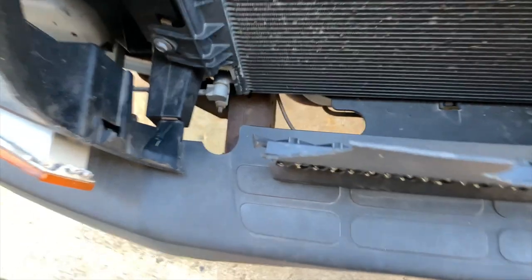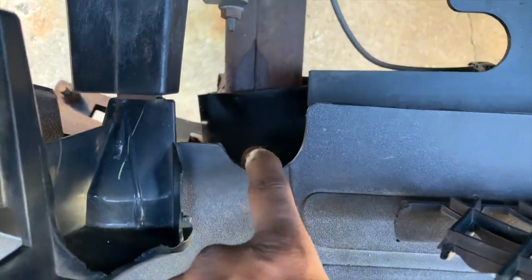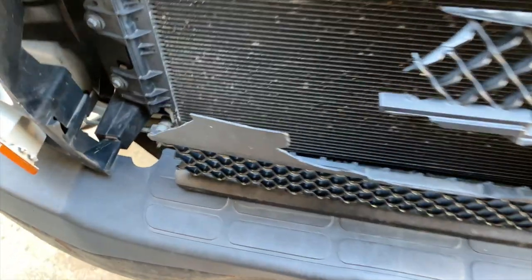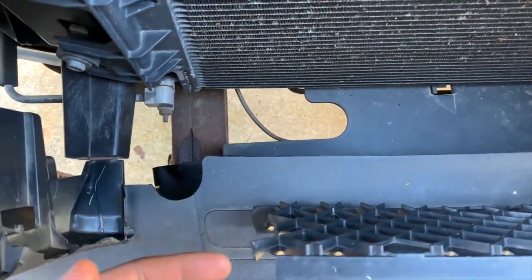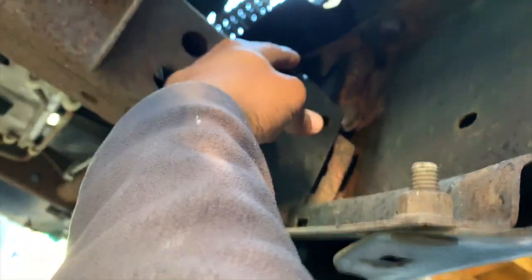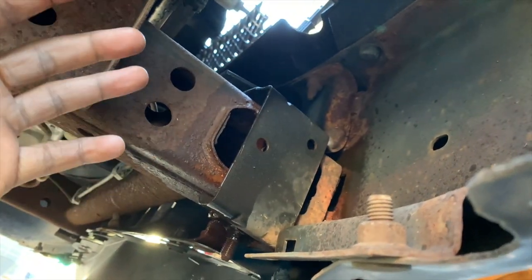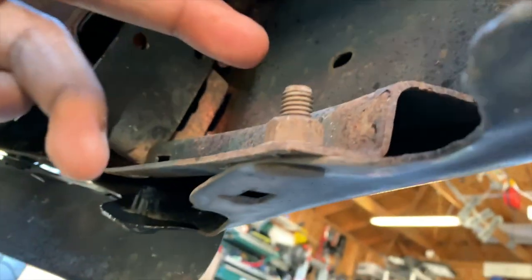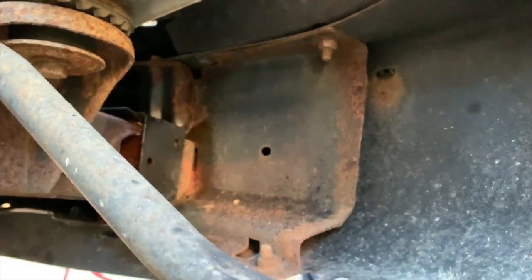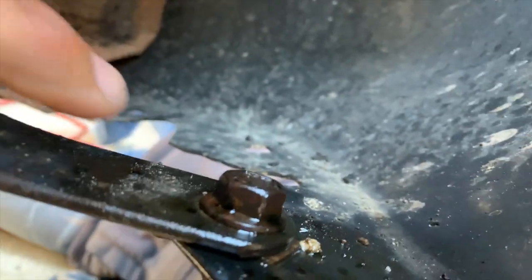Since this van has been in an accident, I'm able to get to the bumper bolts with a swivel on both sides since I'll be removing the front end. But if you're removing the grill as I am, the way I'm doing it should help you. If not, you'll have to go from underneath and get a socket and ratchet up there. Look at the bolt right here — the brace bolts for that brace. Those will be easy to get to.